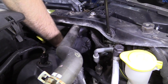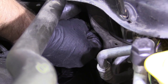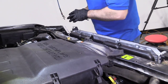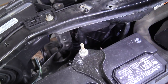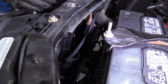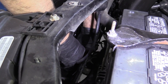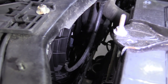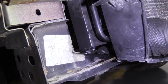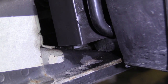Take these bolts and get this one started. Then before I tighten that down, I'm going to get the other one started as well over here. Now I can snug that side up and snug up the other side. Now hook the wires up on the fans — don't forget to hook the wires up; that would be bad. Push the wire retainer back in and do the same with this fan. Before we put the upper mounts on, make sure those feet are in position on the lower radiator on both sides.